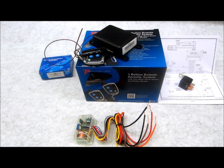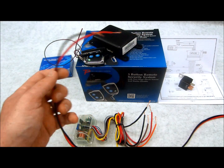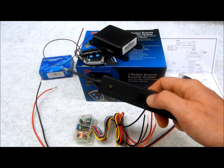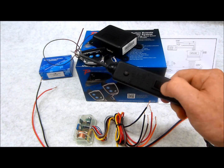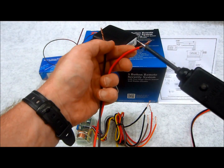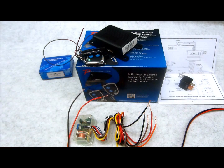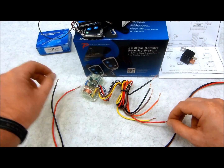If you're new to my videos, let me explain my test display area. I have a pair of wires — red for 12 volts positive, black for ground. Over here is my test light, which looks a bit unusual — it's connected to my power supply. If you hold it down it throws ground, push it up and it throws positive voltage. When there is ground present, it lights up like so.